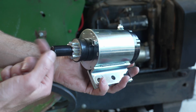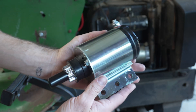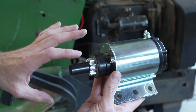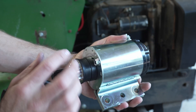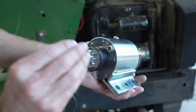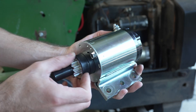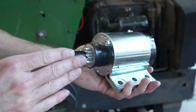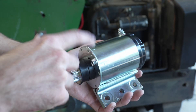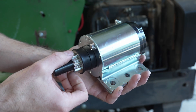There's also a spring inside the end here, which helps push it back into place once the motor has started. What's happening with this one is there is either old grease or dirt or some type of contaminant inside the shaft here. So when you turn the key and that shaft begins to spin, this gear starts to spin at the same speed of the shaft real quickly, and it doesn't have time to kick out. So it just begins spinning as fast as that shaft and it just stays in place, spinning away without contacting the flywheel. So when I tap on it with the hammer and screwdriver, it kind of breaks this loose a little bit and allows that gear once again to spin and kick out like that.